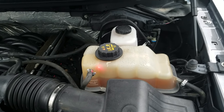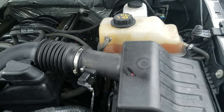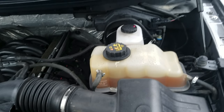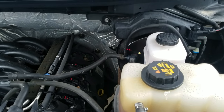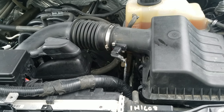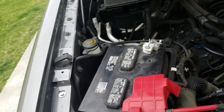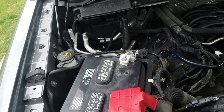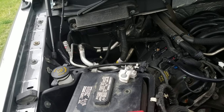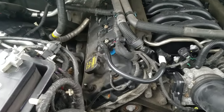This big black piece right here is our airbox. This is our antifreeze or coolant reservoir. Our air filter is behind here. Our brake fluid reservoir is right here mounted against the firewall — that's our brake booster right there. This sensor right here is our mass airflow sensor, which is always located on the intake tube. Obviously this is our battery, here's where we add washer fluid, and here are our AC ports — our low side and high side — with the plastic caps removed.